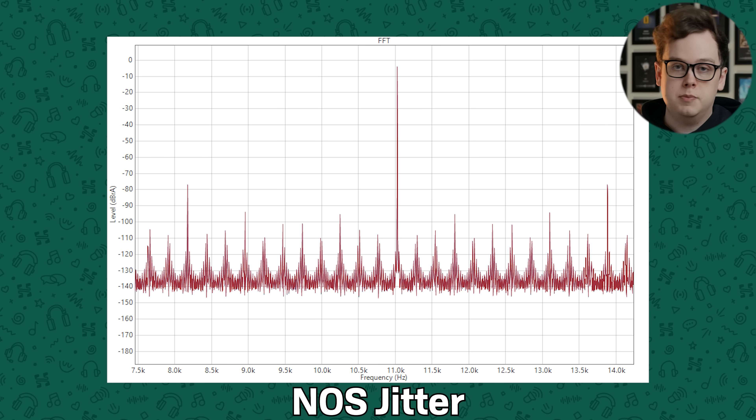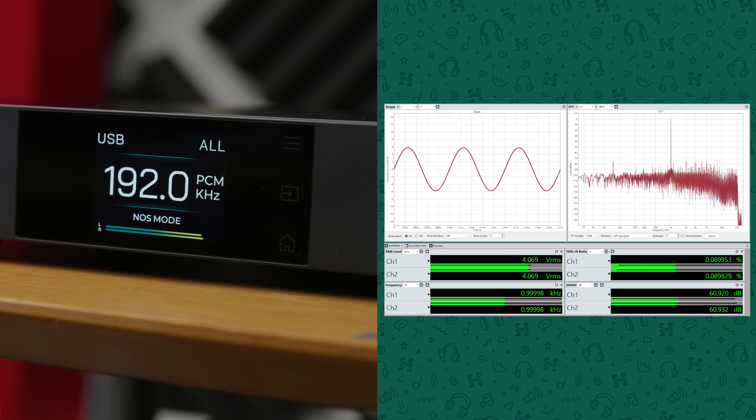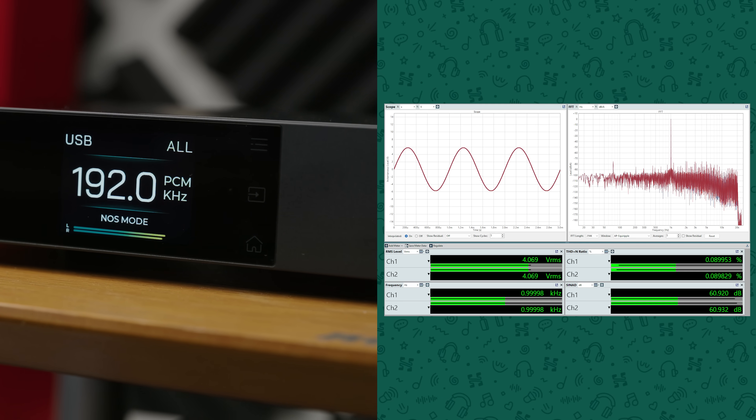Non-oversampling mode on the Centaurus is unfortunately basically broken — it just does not work properly if you're feeding it 44.1kHz content, which is the vast majority of music. It only works if you feed it 48kHz content, and the same DAC module transplanted into the Cyan 2 does not have these issues. Another reason people buy NOS R2R DACs specifically is to take full advantage of external high-performance oversampling from something like a Chord M Scaler or software like PGGB and HQ Player. But you can't really do that on the Centaurus — if you start feeding it high sample rate content, it again starts falling apart, with noise, dropouts, and higher distortion even at 192kHz.